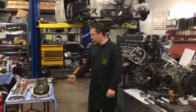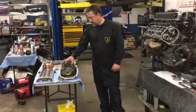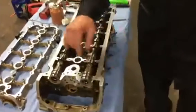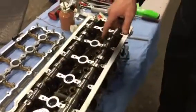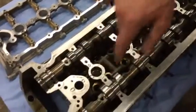With the cylinder head off the car, I'm going to show you what it looks like when you put the camshaft lock tool on and how the camshafts are positioned. You'll see cut-out marks on top of the camshaft where the tool bolts to. You'll also notice the little U's so you can access the bolts on the head to remove the head bolts.